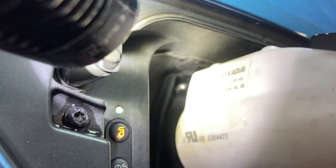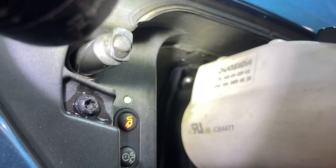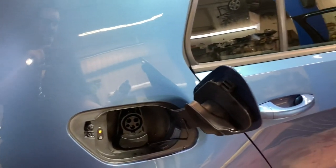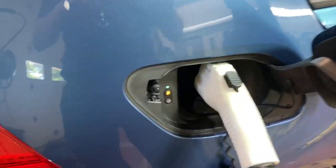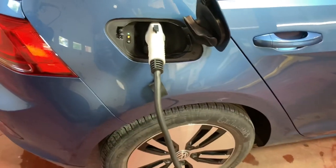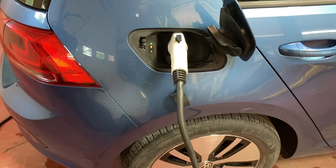As a note, I thought maybe only my AC system wasn't charging, but I also tried it on the DC charger using the plug below and it would not charge either. So this pin is very important - if it doesn't move, it's not going to charge. To unplug it, I usually unlock the door and press the button. On this Golf, even if the car is unlocked, once it starts charging the pin comes out and it locks. I'm going to replace it because it's intermittent and you can't trust it.